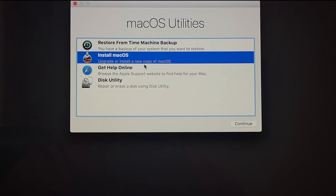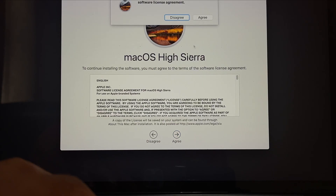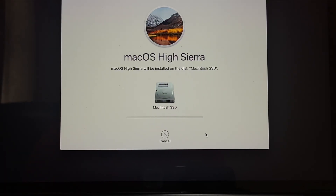Now it's time to install macOS onto the new SSD. The macOS I want is macOS High Sierra, which is outdated. In the past, Apple sometimes blocked installation saying the macOS is corrupted — if that happens you need to change the system date to when High Sierra was released, around 2016. I have a link in the description for how to do that. Click Install — it actually works. Click Continue, agree to the terms, select the new 1.02 terabyte drive, click Install, and wait for it to finish.